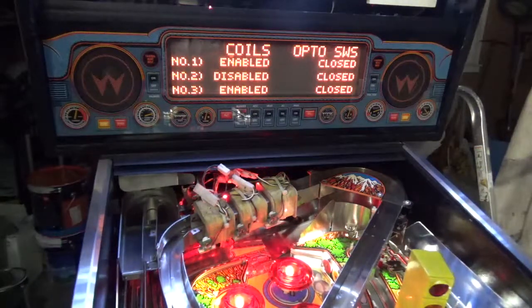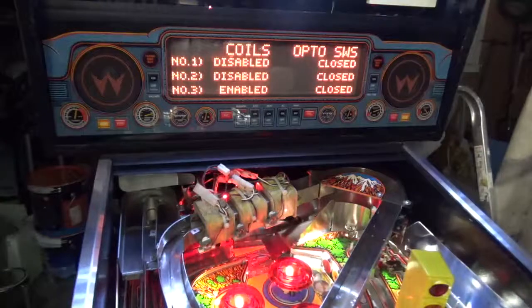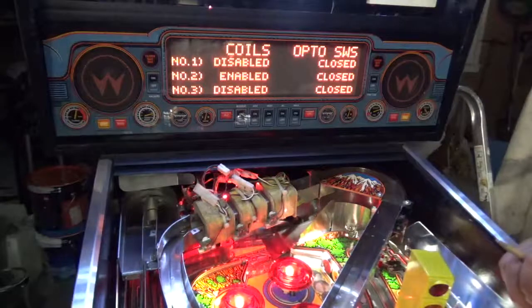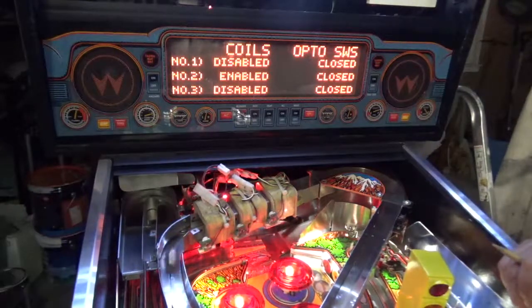We'll turn on each of the coils one at a time, starting with coil number 3 and working backwards. And you hopefully see some kind of magnetization of the ball as it flows through for each one. Obviously, it may not be nearly as powerful when all three are going. So you can see that that fired it through. So it looks like there's some power coming from 3. Just go until the point where 2 is on now. So that's got some force. Force is coming from 2.